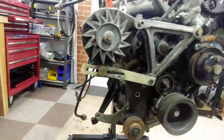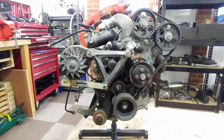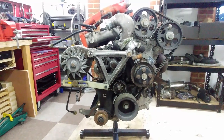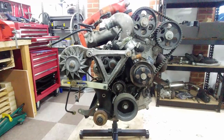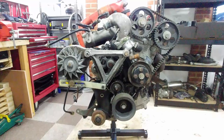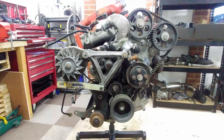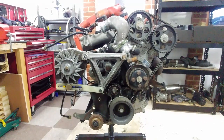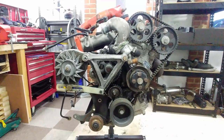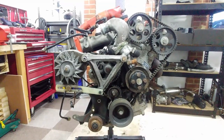Working around the engine, you can see this is where all the belt-driven auxiliary equipment is located. Here you can clearly see the slanted cylinder head as mentioned at the start of the video. Note how far off-centre it is on the engine stand — it's really weighted to one side. The design serves to keep the engine's mass physically lower in the car for better handling. The engine was also initially designed in the late 60s to be the basis of a V8 engine which never actually happened — it looks like half a V8 configuration where someone forgot to put the extra four cylinders in place.